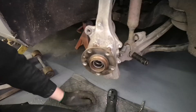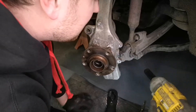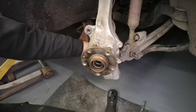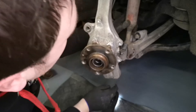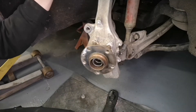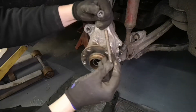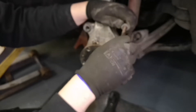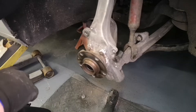I've got a brand new strut top to try — it was £16 for a Febi Bilstein one, so really cheap. Worth a go, not convinced, but sometimes you've got to rule these things out. That's the bottom mount out of the shock absorber, and again the bush looks really good. There's the bolt of doom — these tend to break. When I did the arms last time the bolt broke and I spent about five hours trying to get it out. Not fun, but I did get it out. Again, all the ball joints feel really good, they're clearly tight in there.